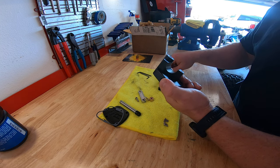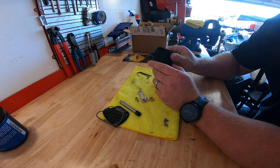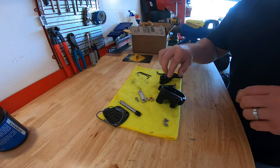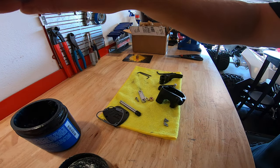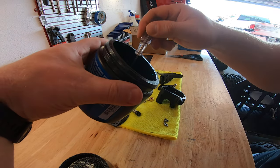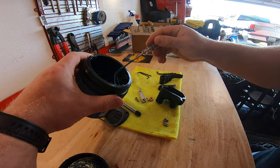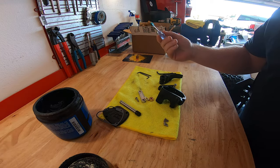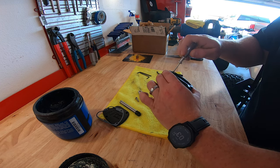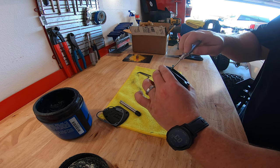You've got the top to the throttle as well as the gasket. Now you don't have to do this — these bearings come with some oil or lube in them — but it's just a habit of mine. Anytime I have something apart I like to go ahead and grease it. These bearings are really nice roller bearings with seals, so they do seal up nice.